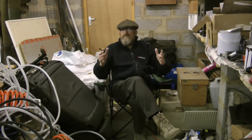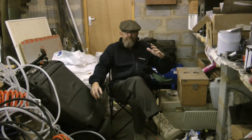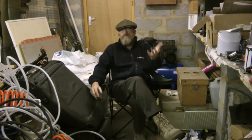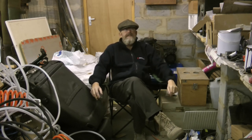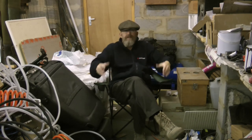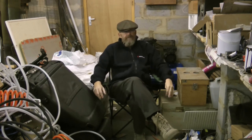Now, so that's possibly one of the things that's causing the crazing, is that the flash off time wasn't enough and there was oils and so on coming through from the paint underneath, contaminants coming through from the previous coat, which hadn't dried properly and it wasn't adhering properly. And you get a degree of shrinkage and so on and so forth.